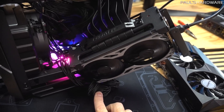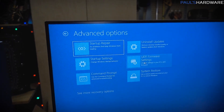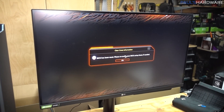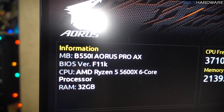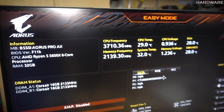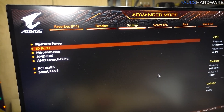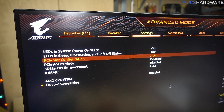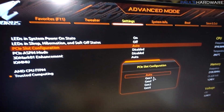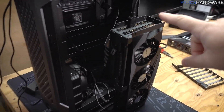The SSD I used already had a Windows install on it — that's convenient. We have video out with our RTX 3080, so now I can get back into the UEFI. I also get to see if my blind BIOS flash actually worked — it did! F11K. The 5600X is recognized. I just need to do two things: enable the XMP memory profile, and over in settings under miscellaneous set the PCIe slot configuration to Gen 3. We're now ready for a test with the RTX 3080.